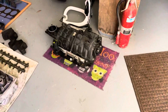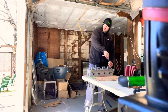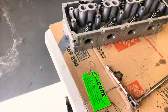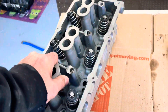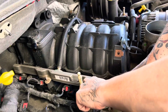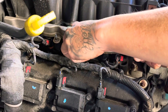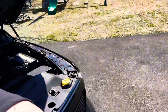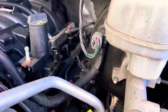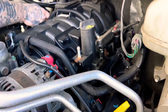The 5.7 port is right there — I'm going to swap it out. Did I say you can use my Homer bucket? You get your own Homer bucket. I didn't bring one today, sorry. It's my Homer bucket. Pop those red tabs, pop off the fuel injectors. Release the fuel off the fuel rail, get the hoses off, then take the bolts off and pop this thing off and swap it out. Let's do this.